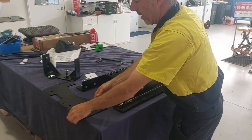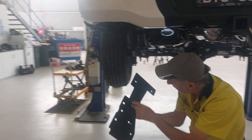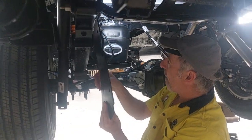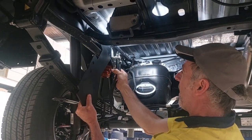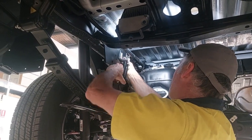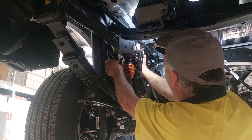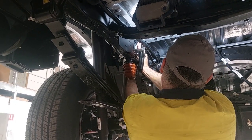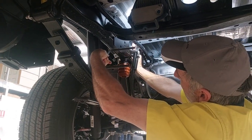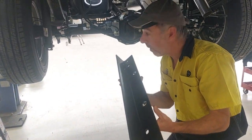When you put the passenger side in, you've got to put it in as a plate just on its own. You put it in with the cut-out for the top hat, bring that up, and slide it behind the bracket for the brake lines. Push it up right to the top. Then get your U-bolt — you come round the back and install one up the front and one up the back. They go on an angle like that, and you'll end up with one coming in under here. Load these 5/8 carriage bolts in, ready to roll.